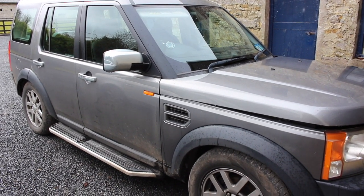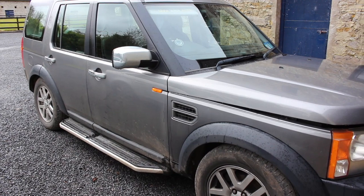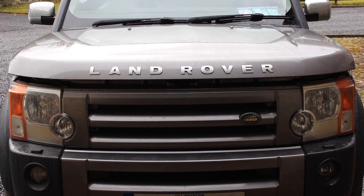Today I'm going to be dropping the tank and replacing the low pressure fuel pump on this Discovery. It had been having problems for about a day or two where it would lose power under acceleration and go into limp mode. It then got quite hard to start, so after plugging into a code reader it was bringing up a P0087, which is a low fuel pressure error code. After checking the fuel pressure at the engine I found there was no pressure getting to the engine at all, which leads me to think it has to be the low pressure fuel pump that lives in the tank.